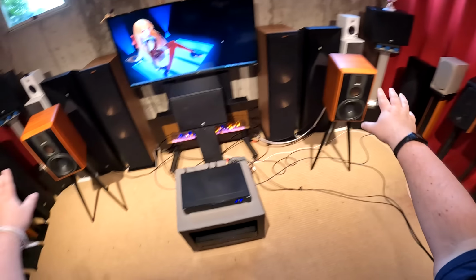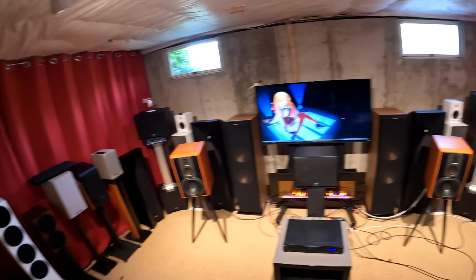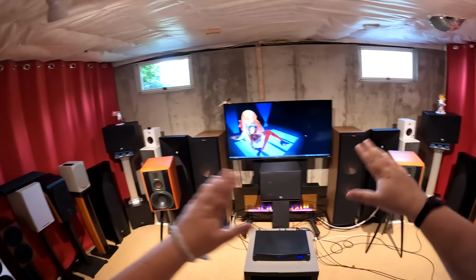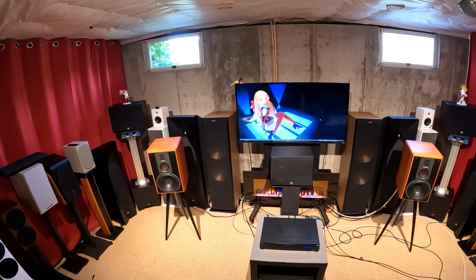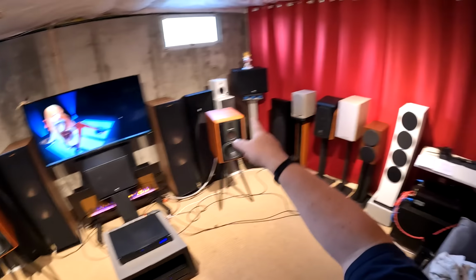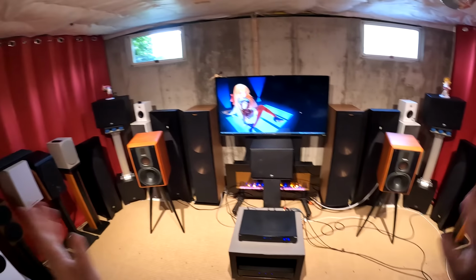Because I had those speakers close, and then I moved them further away, and now they're 12 feet apart, and I get the most amazing sound stage. Not for music, but for movies. It's just explosions across the entire spectrum. And the only reason that works is because there's no low end coming from there, none from there, cut it off from there, feed it to the subs in the perfect position, sit in my perfect little position space, and it's great.